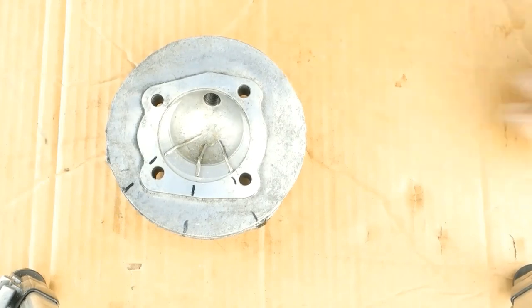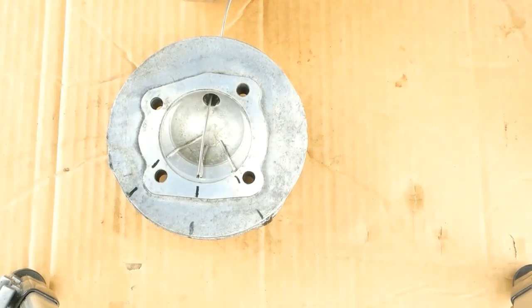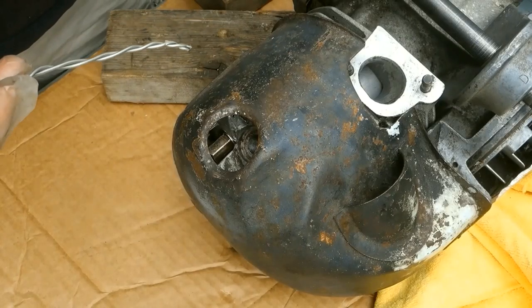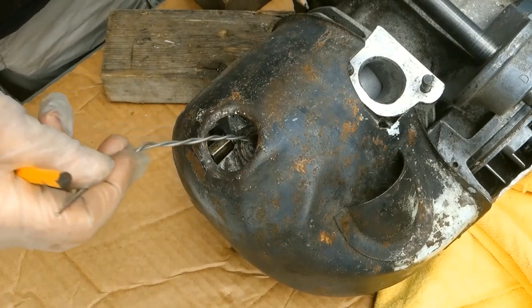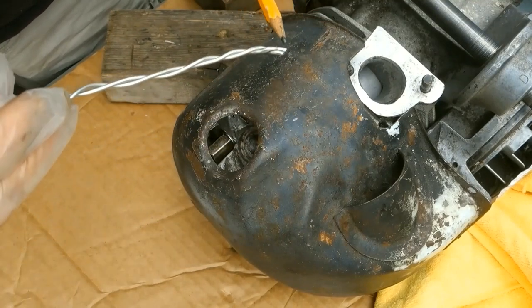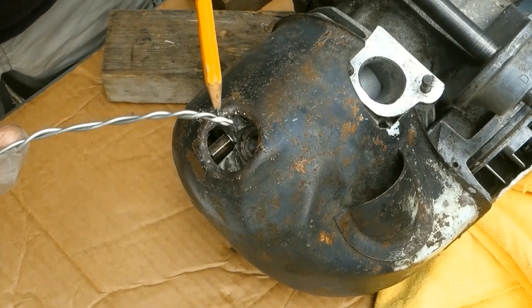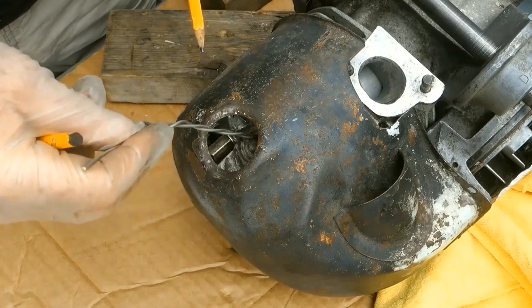And I've put marks on the outside as a guide for such an instance. I tried this method on my other scooter with the engine in place and the cover on. Not so easy. I struggled. This is 2mm solder. I doubled it up. Eventually got a reading of around 2.06, I think. It's best if the engine's dropped and the cover's off.